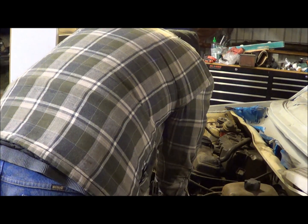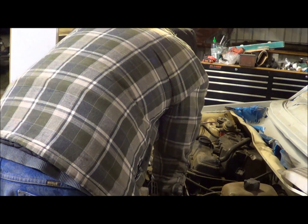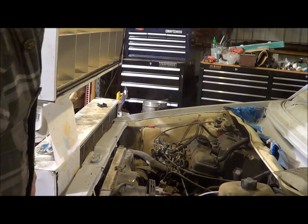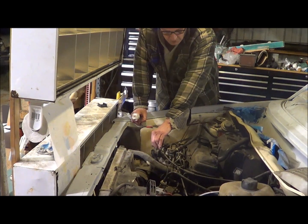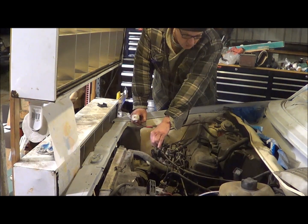Here we go — I don't know, just a little tweak. It's a little bit rocky but I've got the pump retard pulled all the way out. I'll give it a little go juice. It sounds like it's running on maybe three cylinders. When you get it to smooth out and get the injectors to play, it'll be a good engine.